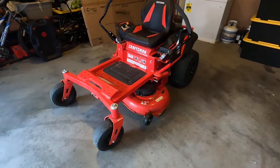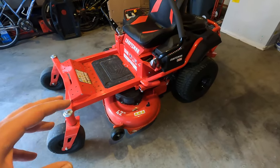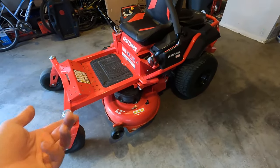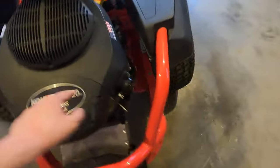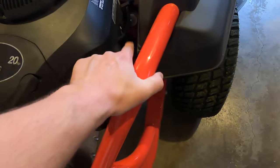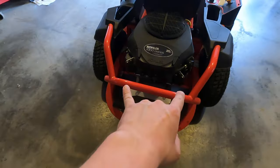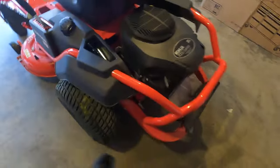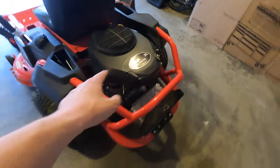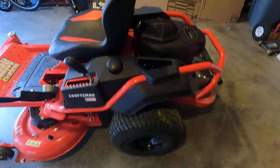And we're back. Just a quick heads up for what I'm doing for my standard preventative maintenance right here in the spring of 2024. I'm going to be changing the air filter, the oil and the oil filter, the fuel filter, and the spark plugs. We're also going to put some Seafoam and Tecron in the fuel because I've gotten a little bit of backfire on this unless I run it at low revs right when I'm done cutting the grass.